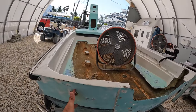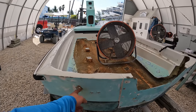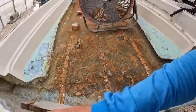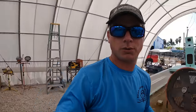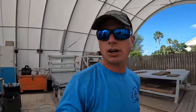so that way our trailer hooks for the trailer straps, those eyelets there, will be in the coring, and we're going to go all the way down to the bottom. So from here all the way to the top will be coring, and we'll go just to right here on the edge of the transom with our coring material. So let's cut our mat first. Once we get our mat cut, we'll cut our coring, and then once our coring's cut, we will cut our woven to go over the coring.